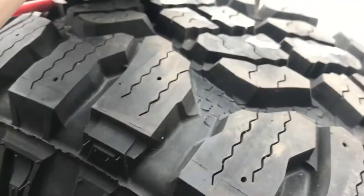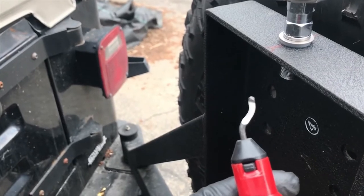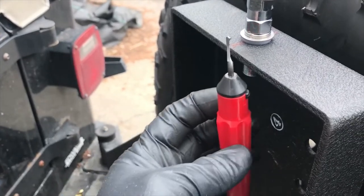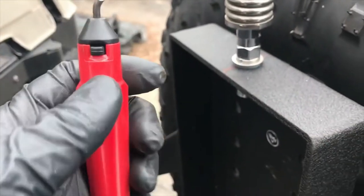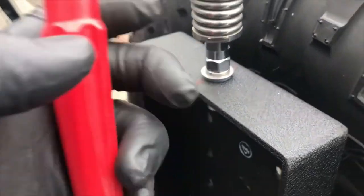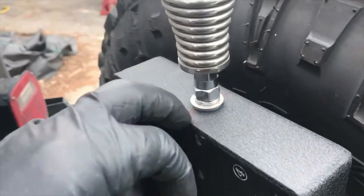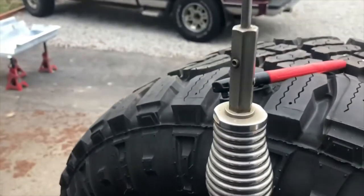I've got it mounted here with the adapter, isolator sleeve, lock nut, washer, and the coupler for the cable. I did use this great little deburring tool — if you're doing a lot of drilling and fabrication, you should pick one up. You stick it in the hole and swing it around and it puts a chamfer on the edge, cleans up any extra punch-through material, and gets the mounting surface nice and clean.